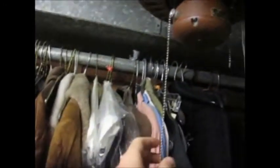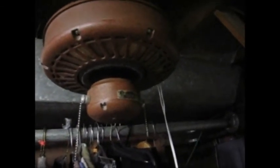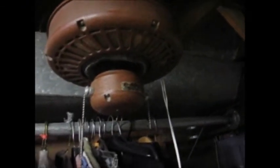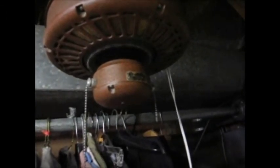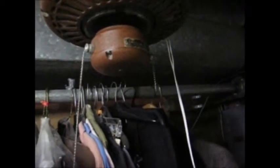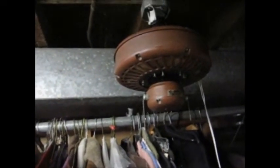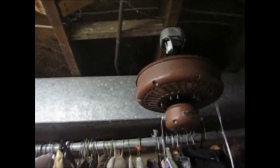Let's have a look at the Casablanca tag — it is made February 1995. It brings me back to the sixth grade. Let's just fire it up. Still got a little bearing noise. Looks like it has some wet bearing noise, but I'm not too concerned about that because this is an outdoor fan — being hung outdoors, it probably would not matter too much. I'll just probably put more drops of zoom spout in as time goes on, because I think that's what helped eliminate the noise.